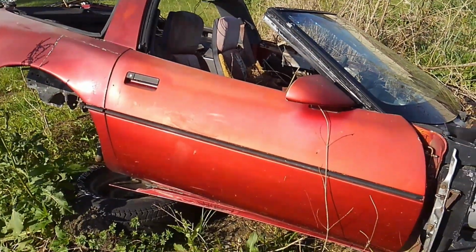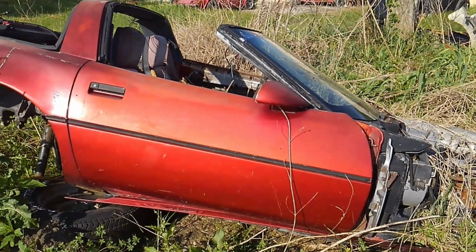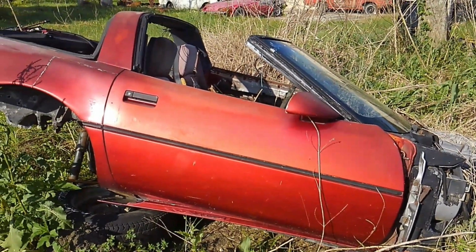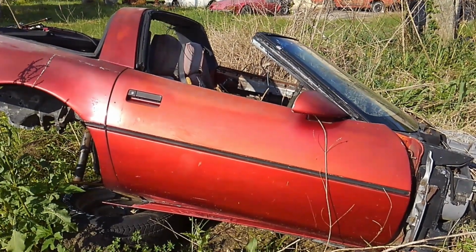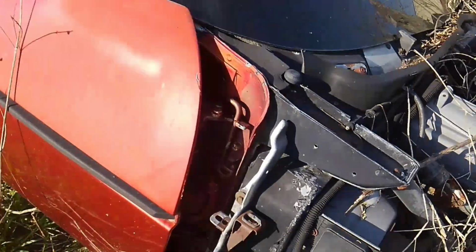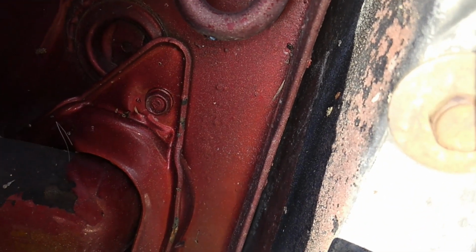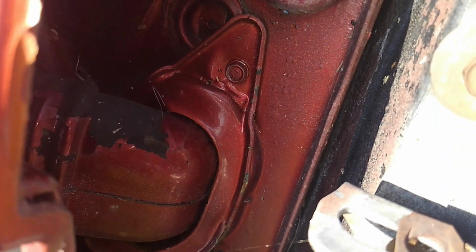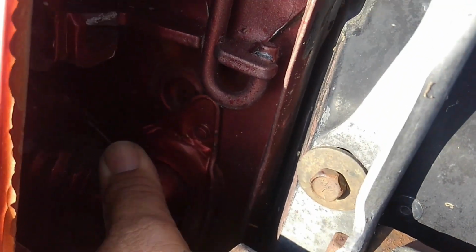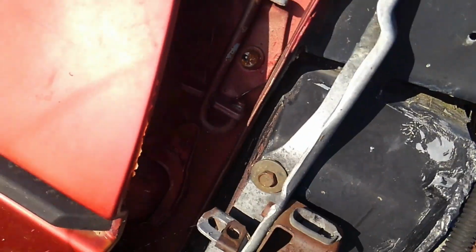But anyway, today in this video, what I'm going to focus on is pulling the doors off of all these cars. So that's 6 doors. And I think a few months back I made a video on removal of the doors on the C5s. Those are relatively easy. These are not bad. Same kind of setup here. You've got 3 bolts here, 3 bolts on the bottom hinge, and you've got another one there. It holds that wiring loom harness inside there, so you got to unbolt that. But it's pretty quick and easy, 11mm, 7mm.